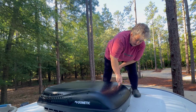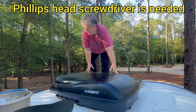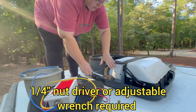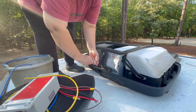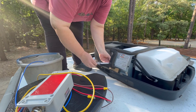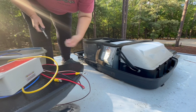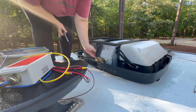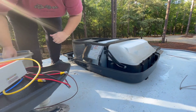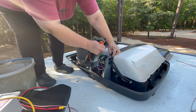To remove this Little Guy Max Dometic air conditioner there are four screws — two on the front and two on each corner. You'll need a one-quarter inch hex head nut driver. I'll take this cover off, and once you pull it up I usually break the foam right here to get it out of the way.